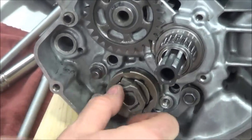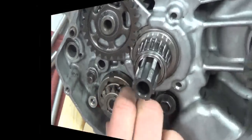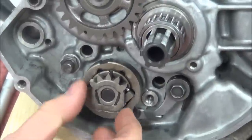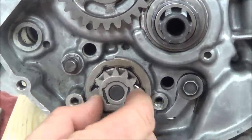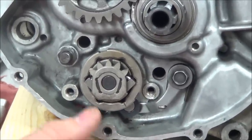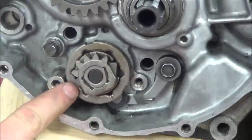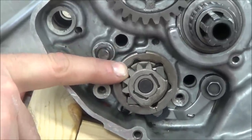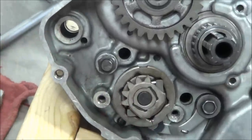It only ever spins about this much for an upshift and a downshift. When I go one direction, this finger takes the drum that way; if I go the other direction, this finger right here goes that way, rotating the drum. The opposite finger rotates the drum the other direction — really a simple design. Going the other way, the other one compresses the spring, allowing it to go inside itself.